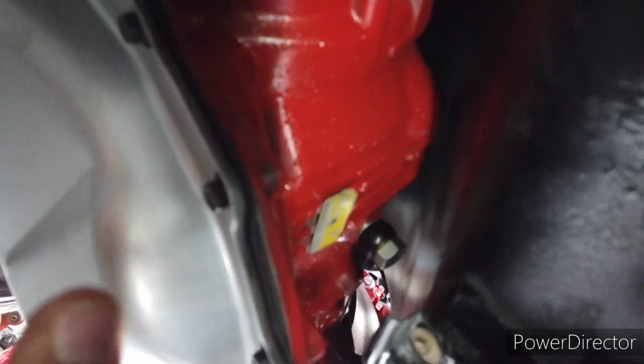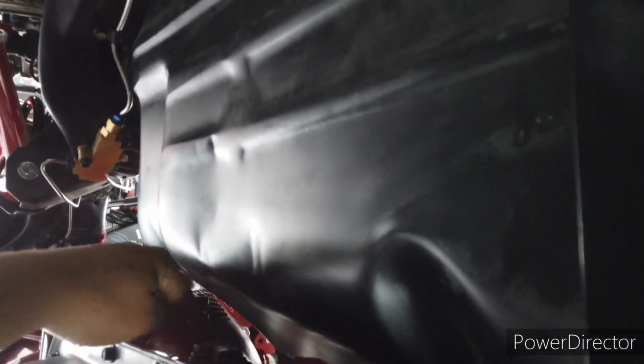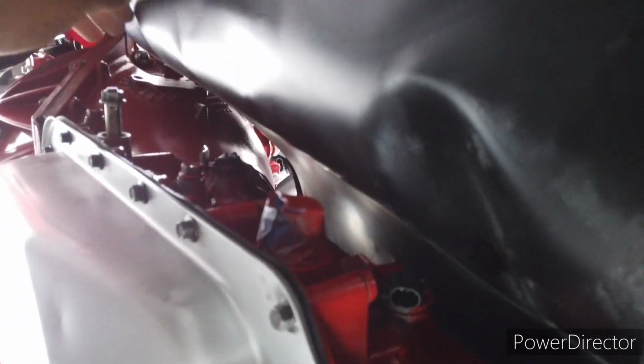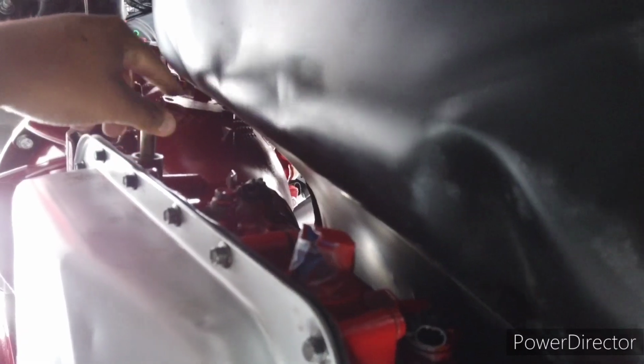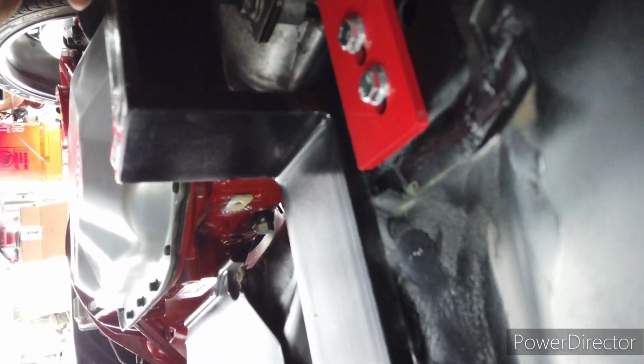And I think, just talking to my buddy about seeing if the transmission will get too hot to run the cooling lines underneath of it or on top of it. So I might run them forward a little bit, just route them around the top of the transmission. There's plenty of room up there. I'll have to keep in mind for when I do the steering linkage, not to interfere with that. But I think I'm just going to route them over the top of the transmission and then tie them onto the transmission cooler, and hopefully we should be good there.